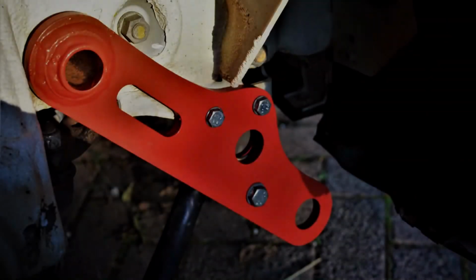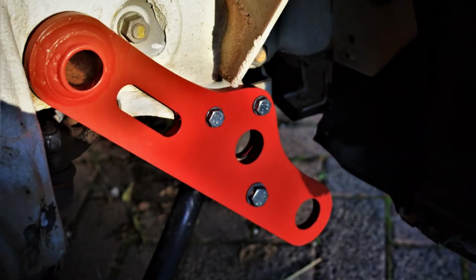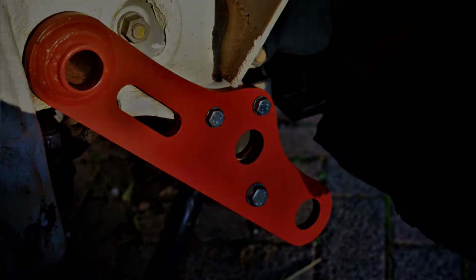So it's good to have aftermarket recovery points. Look at where they are located. There's a lot of aftermarket recovery points available. As soon as you are driving water, mud, sand, the aftermarket recovery points that get fitted on your chassis are too low. So rather get your recovery strap fitted to your points before you take on that obstacle. Your only other option, if you want to get those recovery points higher, are aftermarket steel bumpers.